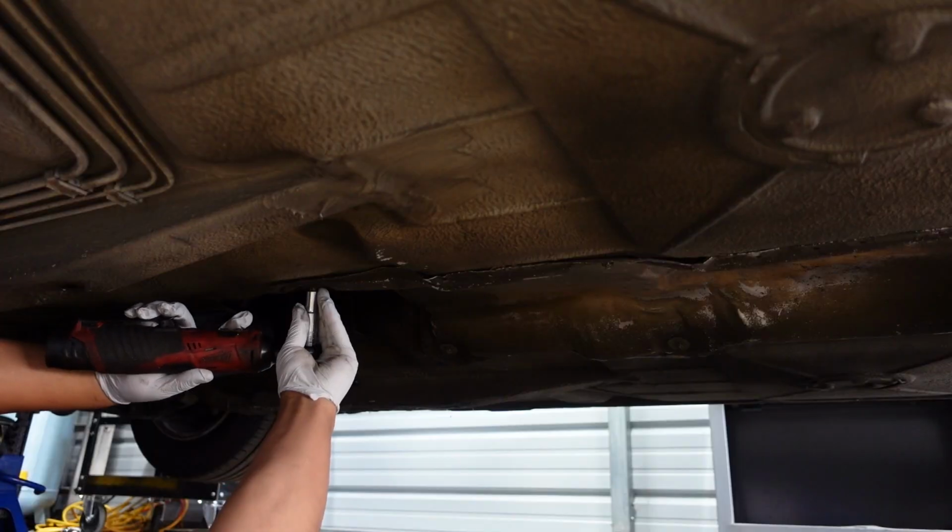Day 2 of this project, we're gonna remove the transmission today. We're down to the last bolt, and you guessed it, it's the one at the very top of the bell housing that's impossible to get to. So we're gonna go ahead and lower the transmission a little bit, try to pitch it back, get to it, and then remove the whole thing. We got a few things to unbolt on the way there, but shouldn't be a problem. It should be pretty seamless from this point on, but you never know. Things pop up, things break, so let's cross your fingers.